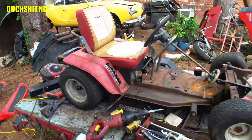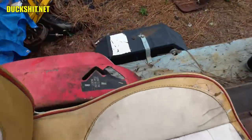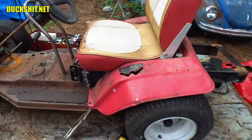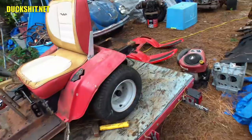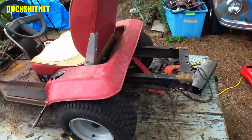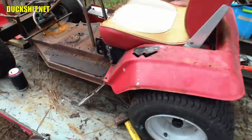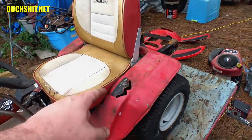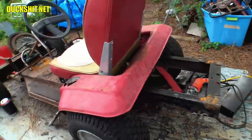If I cover up the shifter hole in the fender here and the deck hole and the shifter hole on this side to fill them in, I think it'll look a lot less mower-ish. This is actually supposed to be a go-kart, not a lawnmower race vehicle. I think that'll do a pretty good job of keeping the mud and crap off of the rider. It needs to come up a little more on this side — I don't have that inch and a half clearance I have on the other side. We'll drop some bolts in there on both sides, bend this up a little more, bash out the sides with a hammer and saw, and then I'll start welding the fenders together and preparing some brackets.